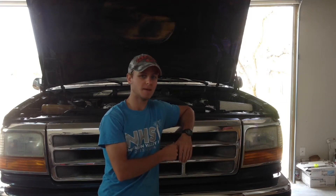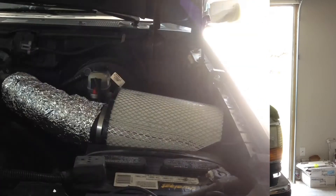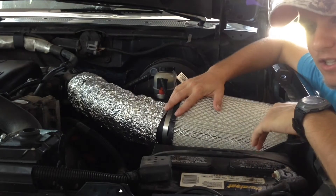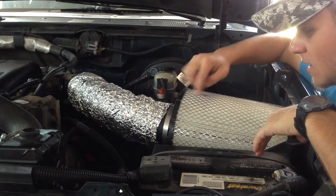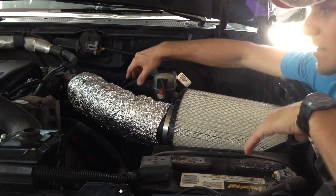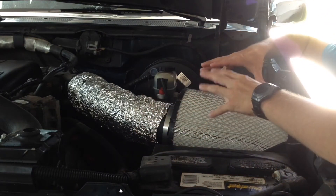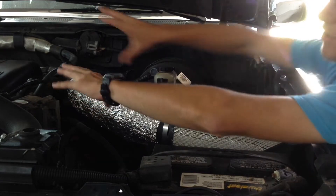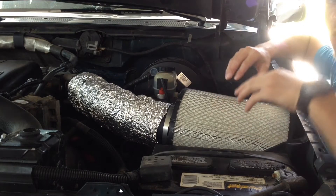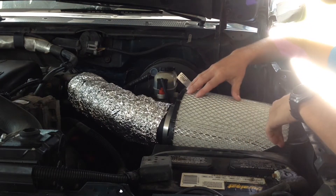I've got another truck project going on and I'm actually going to be building myself an air intake box for my Ford truck. I'm running a pretty standardized intake — this is actually a NAPA 6637 air filter. This works great, it flows a lot of air, but the downside is it pulls hot air because it's all inside the engine bay right next to the hot engine. I want something that's going to be more factory-style and that's actually going to be pulling air as cold as it can possibly be.